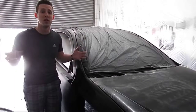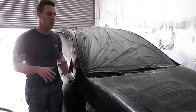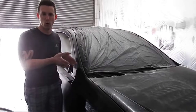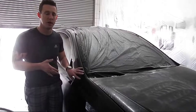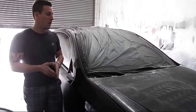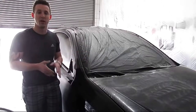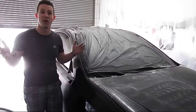You're talking about hours alone just in sanding, because if you try to rush it, what happens is you don't remove the scratches from the more coarse sandpaper. So when we hit this with 1000 grit, if we were to then hit it with 1500 grit and try to move too quickly around the car, we wouldn't remove the 1000 grit scratches. When you go to compound it you realize you should have spent more time sanding.